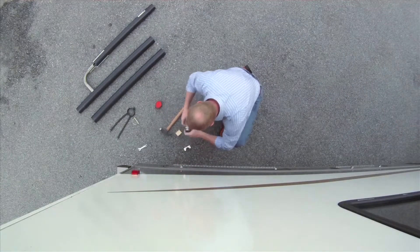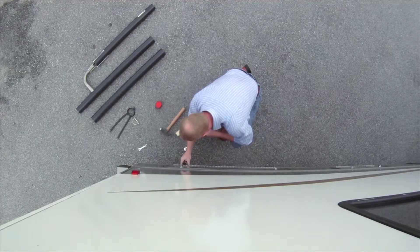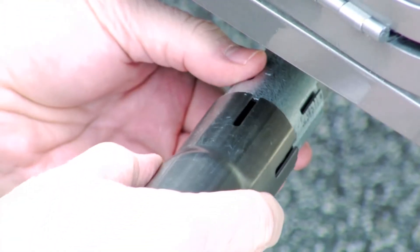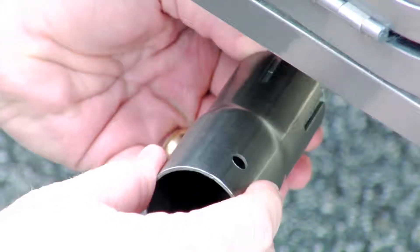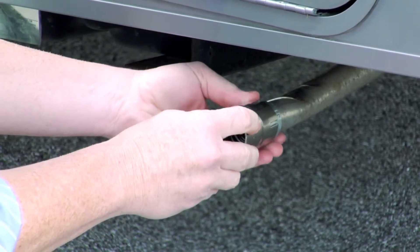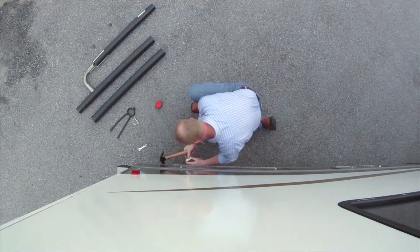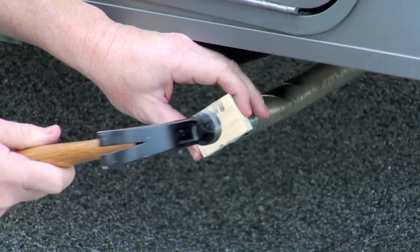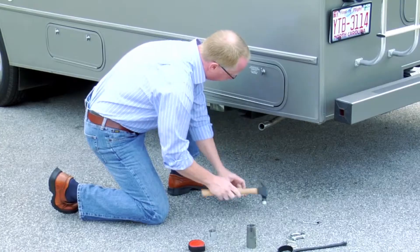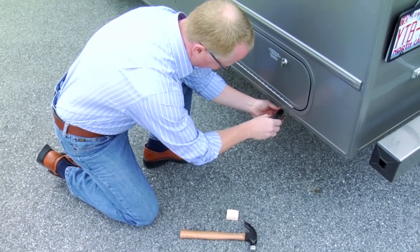Next, you will install the bushings and the mounting adapter. For best results, install the bushings one at a time. Start with the smallest and work up to the largest. All bushings and mounting adapters go on slotted end first. Be sure to offset the slots to provide a good exhaust seal. Tap the bushing or mounting adapter onto the exhaust pipe if necessary. Never strike the bushing or adapter directly. Use a wooden or plastic block to prevent damaging the diameter or surface of the bushing.